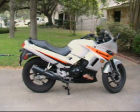Tire size, it has 16-inch wheels, as opposed to 17-inch on most modern motorcycles. The normal tires for it are 100/80 on the front and 130/80 on the back. This is fitted with slightly larger tires. They're 90 millimeters wide instead of 80. And those fit fine, and a lot of us Ninja riders think they do a little better job. So that's the basic overall view of the Ninja 250.